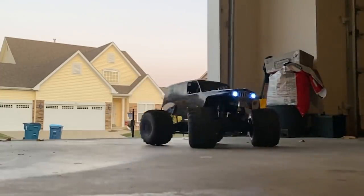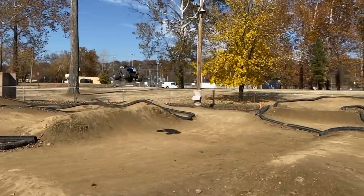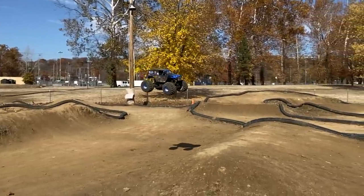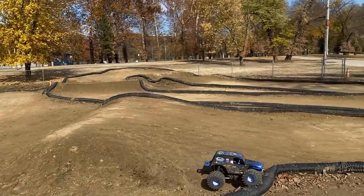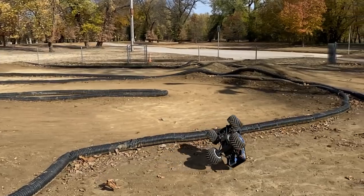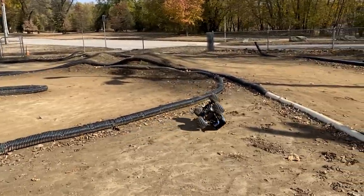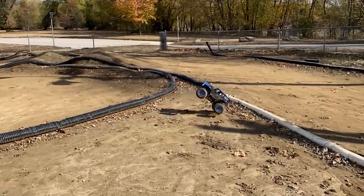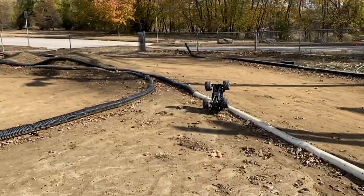The fluid is heavy enough that it acts almost as a limited slip in cornering — the differential still unloads in a good way, but when you need limited slip it helps. You can power yourself out of a lot of binds — like a real monster truck where the rule is always 'power out.' Running locked differentials on an RC monster truck just doesn't work well, and fully open diffs aren't great either. This is the best of both worlds, and it's completely tunable.